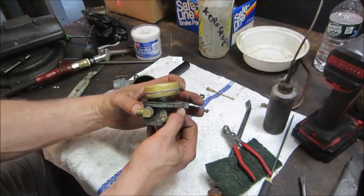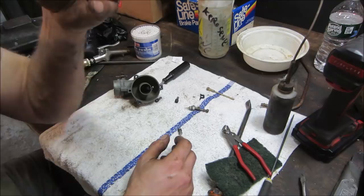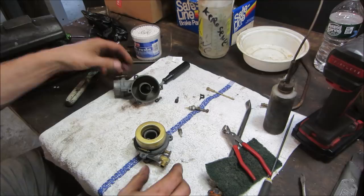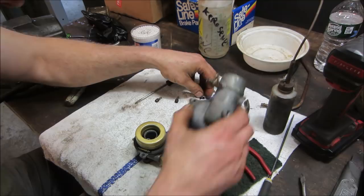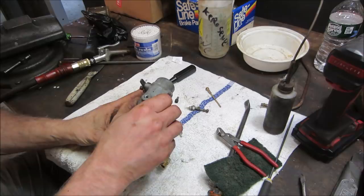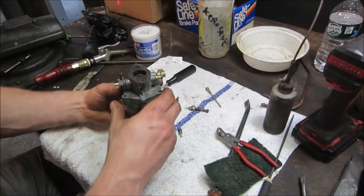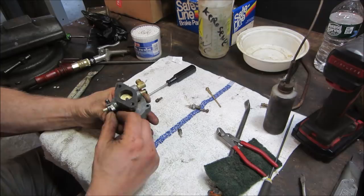Normally you put a drill bit under there, a certain size, and it tells you the gap that you set the float to. It actually looks pretty good. I always just kind of go with straight across when it's flipped over. I'm going to blow in it, and then flip it over, and it's working. I don't think we have anything else inside this, do we? A little broken piece we're going to piece back. Keep the fuel in the best we can. They could have used their turn on the wire wheel.